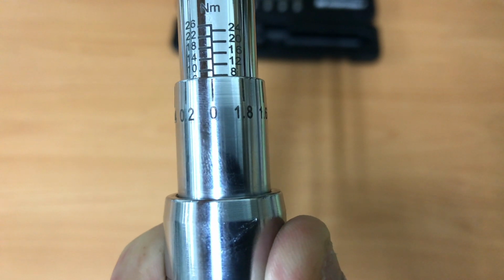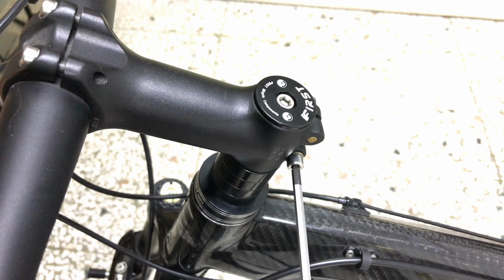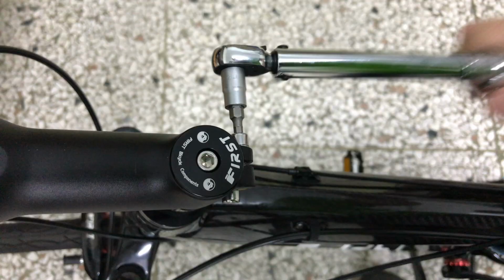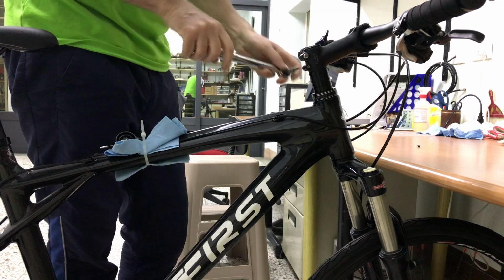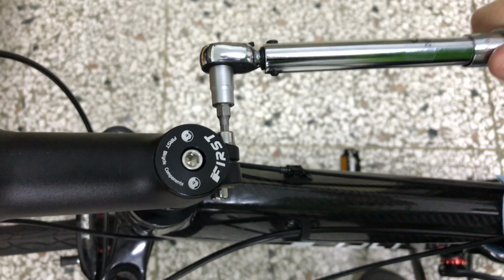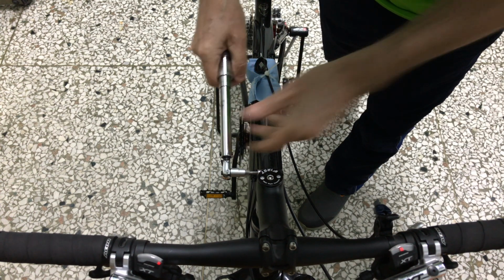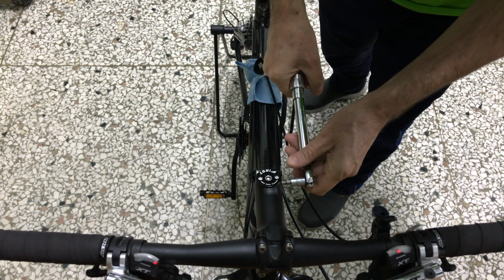Zeroing in, literally, on 8 newtons. Release the lock back into position and you're in business. It's best to tighten each side in turn, bit by bit. Once the wrench clicks in at the specified torque, do the other side. Tightening that side slightly loosens the opposite side. Once both sides click easily, you have reached tolerance.